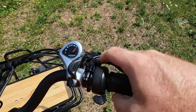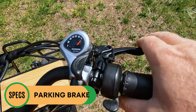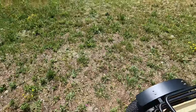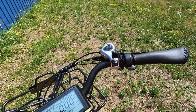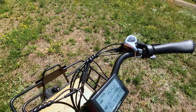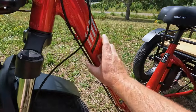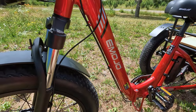There's a small nub on the right lever — that is the e-brake or parking brake. You pull the lever down and push the nub to lock it, which locks the rear hydraulic disc brakes so the bike cannot be moved. Really nice for getting on and off without worrying about the bike rolling away. Both hydraulic levers have motor cutoffs. The wires are fairly nicely wrapped going down to the down tube — they are not internally routed cables, so not the cleanest look, but if you ever need maintenance, you'll be happy they're external.